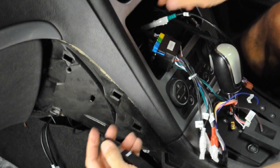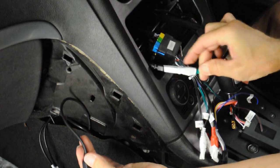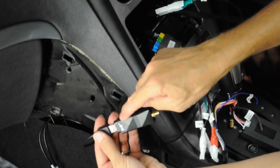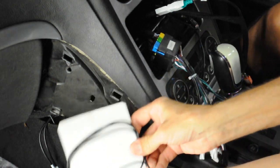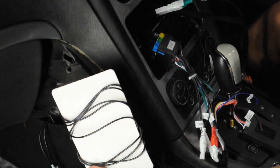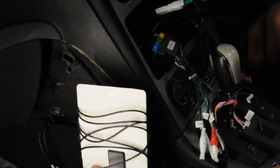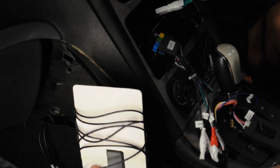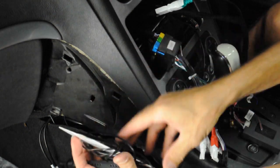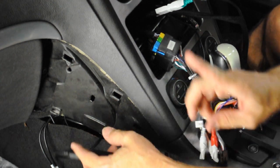The first USB, the one that says '4G' on it — I've used that for the DAB radio. I've extended it with a USB cable and run it down the back. This is the window-mounted DAB USB antenna; it's pretty useless if you're not in a high-power area. I'm about 20 km out of the city where the DAB transmitters are and reception flicks and plays up.